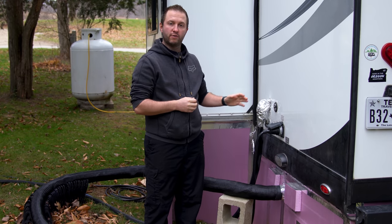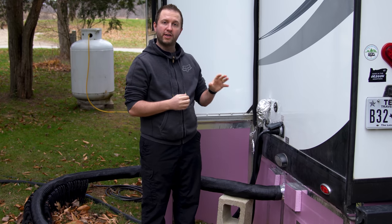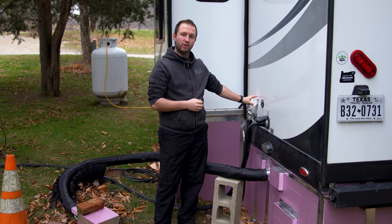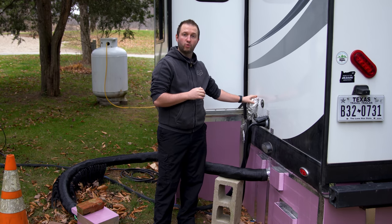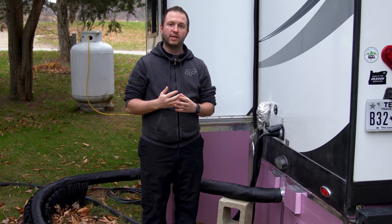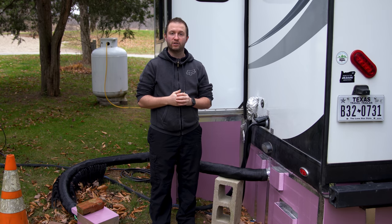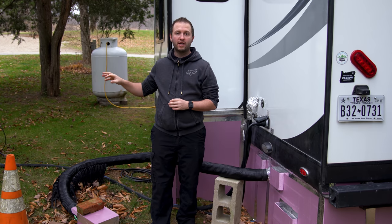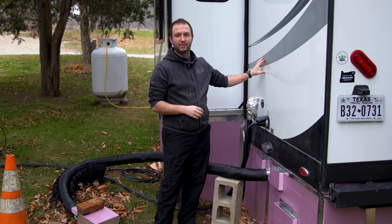We're monitoring the power usage through a smart plug connected to our home automation system. We've wrapped the connection end with foil tape and insulation, and there's also a pigtail heat trace on the hose to keep that area from freezing. At the RV park water outlet end, the whole system is buried and our neighbor's heated hose — which has constant output — keeps that whole area very warm. We've even installed a short length of normal hose and a water filter down there to ensure filtered, non-frozen water coming into the RV.